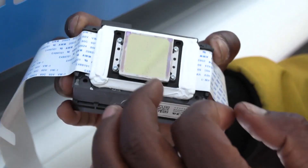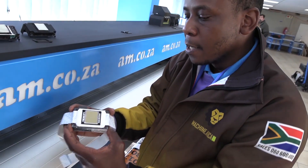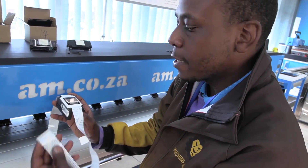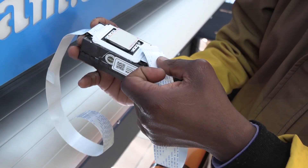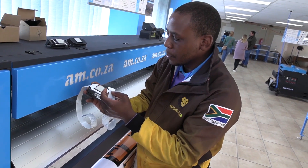This is a special type of silicone — not the same silicone you get from a hardware store. It is engineered to be very resilient against inks eating it. This printhead has the advantage that there is no risk of you misaligning the tracks when connecting the cables and accidentally inserting the cable skew, which could cause an error 16 or the printhead getting electronically surged.